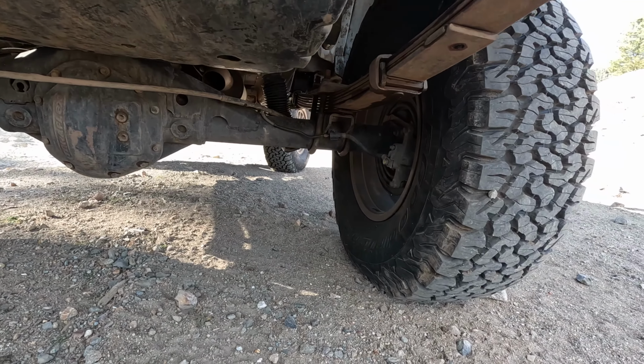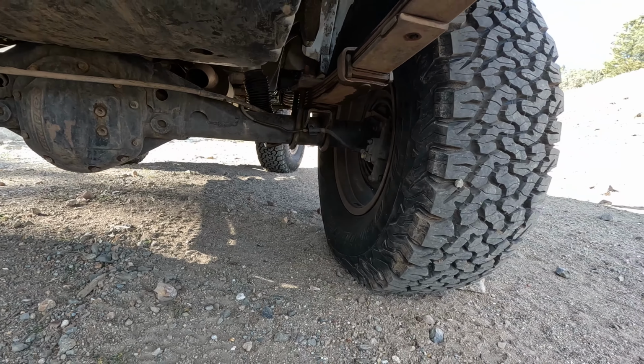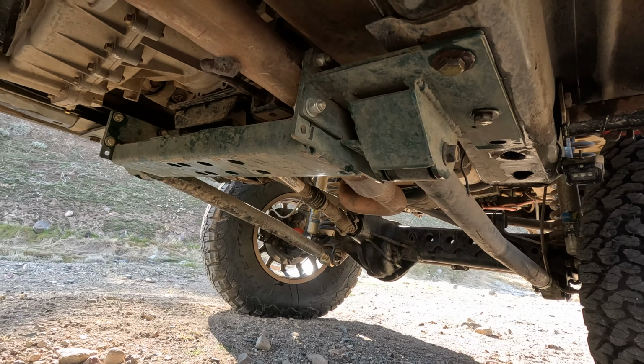But basically with 37-inch tires and the configuration he has with the manual Jeep with the low transfer case, big tires, he's not gonna break it anywhere. So it's ready for all the heavy trails we can throw at it right now without going into 1-tons and 40s, because this platform works. 37-inch tires on the Jeep Cherokees, they work because the wheelbase is not very big. It's only about 102 inches, so very good for our areas here in Northern California.